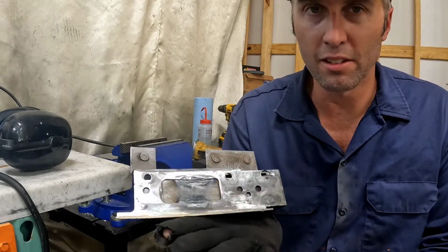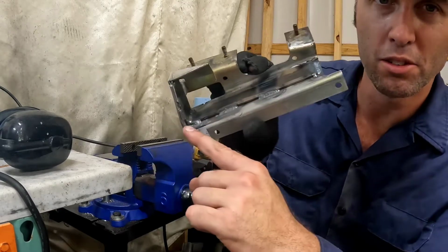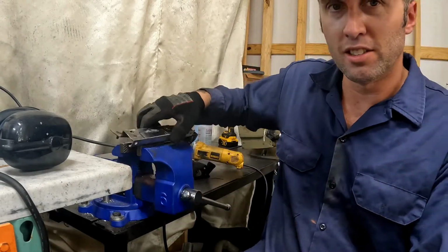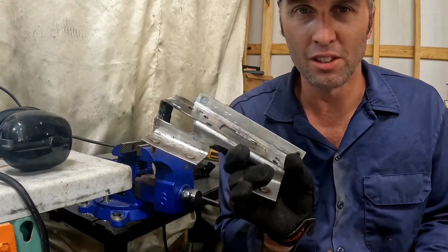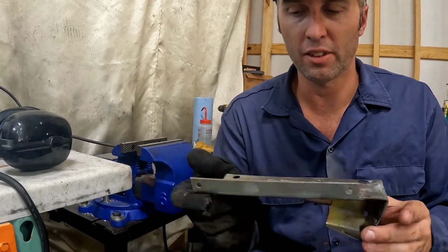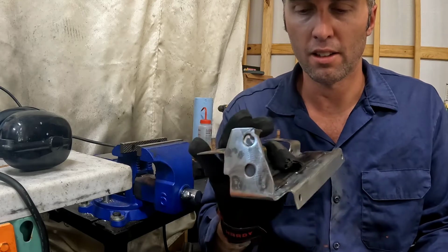And the outside of the bracket looks stock from the top down, really, but I added a 1/8 inch steel spine basically, and also an 1/8 inch strap on the back to tie it together to the floor. So now when this thing is getting torqued on this way, you could feel it now. The bracket doesn't flex anymore, so it's plenty strong for the application I'm going to use. And then once the side bolts and the bottom bolts are tied into the car, I've got 3 stainless bolts that are going to hold the drift brake itself to this 1/8 inch backer. That's going to be plenty strong.